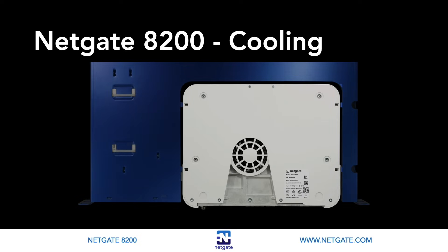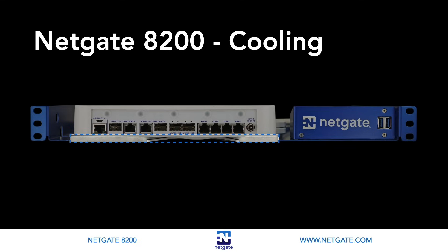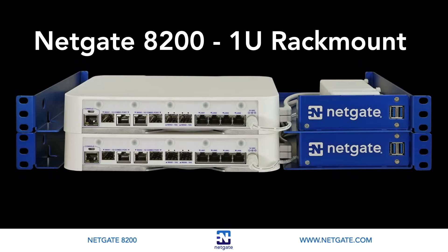The NetGate 8200 is actively cooled. It uses an oversized die-cast aluminum base that serves as both system chassis and heatsink. The die-casting process enables placement of heatsink material exactly where needed for optimized thermal performance and cooling airflow. An actively controlled cooling fan is integrated into the chassis base plate and automatically adjusts its speed based on the device's temperature, allowing the unit to remain uncharacteristically quiet and efficient. Airflow is drawn through a large notch channel in the base plate — visible from the front view below the network ports. Cool air flows through the fan intake, up through the chassis, and out the vents in the lid. Please do not block the air intake channel. The bottom can be placed on top of another device as long as the intake channel can pull in air unobstructed. The 8200 ships in a 1U rack mount configuration designed to ensure proper airflow even in the tightest rack cabinet.